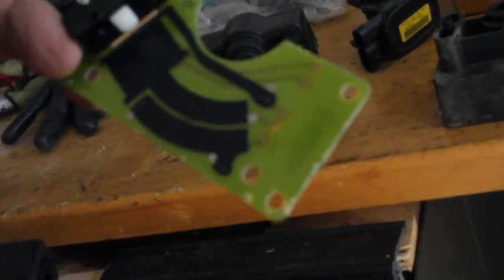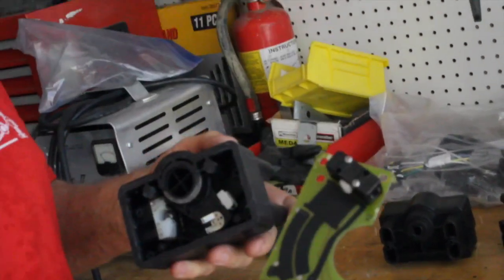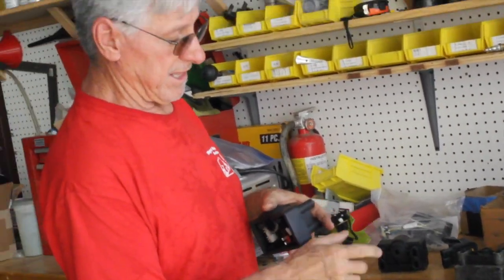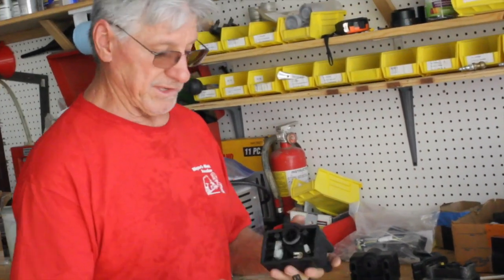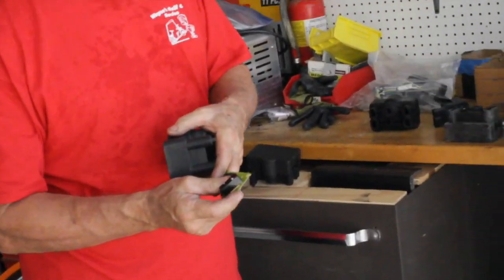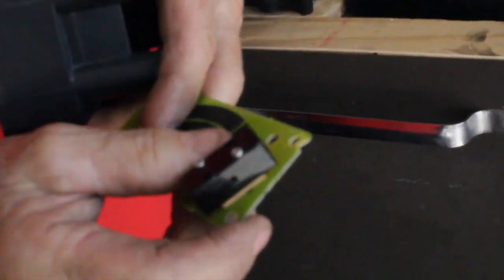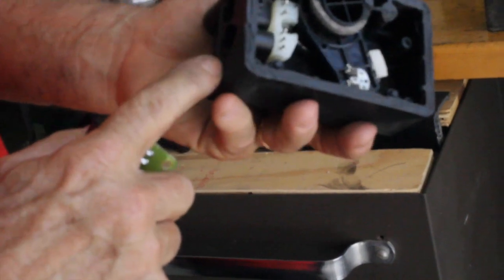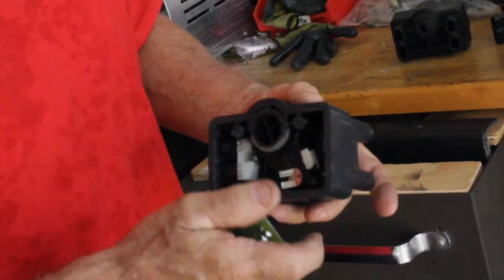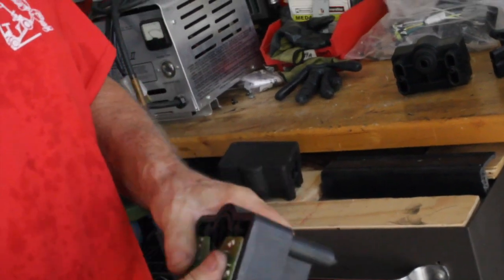When it does hesitate, until you get past that worn spot, it opens up. You can't buy the internal parts — this is proprietary to Club Car, so you have to buy an entire new unit. This is the micro switch that the two wires go to, and the other three are your rheostat that controls the speed. So this is a sealed unit, which is why they're a bit pricey.